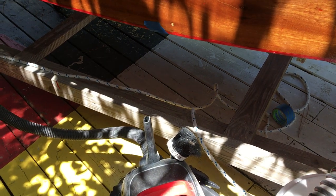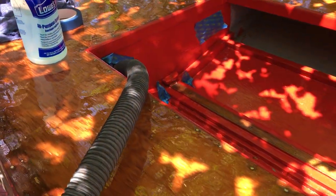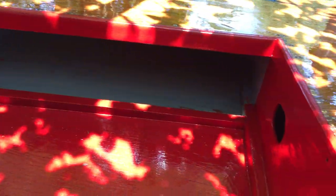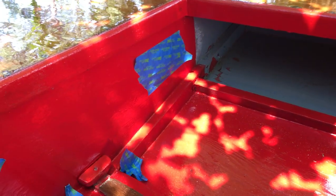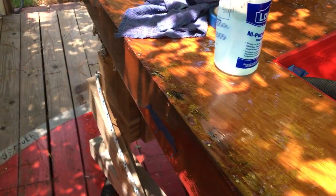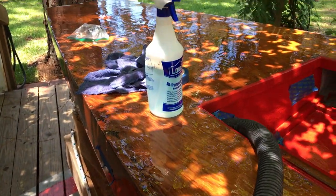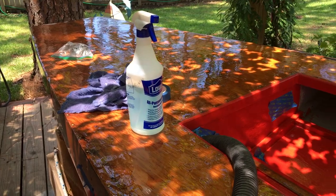What we're doing is taking the shop vac — it's got some low pressure air, volume about medium. A boat like this, we're not worried about foam blocks inside to dislocate or anything like that. So we taped up the holes on the cockpit wall. We've already done the bow section; now we're back doing the stern section, taped over the holes and the little limber holes. Got the hose going in there, so we're going to start the vac up, and then we'll spray and you'll see where the little bubbles come out — that means there's air coming out causing bubbles with the soapy water mix of Dawn dishwashing liquid and water.